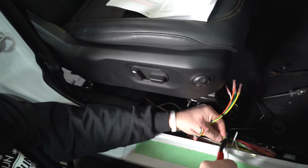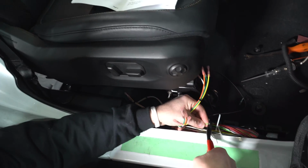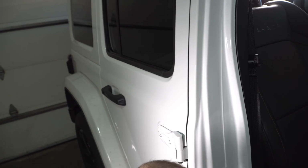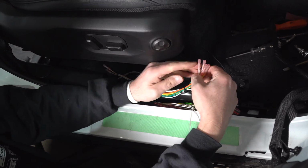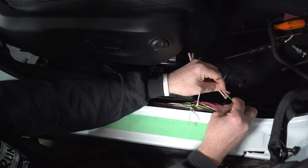Now to confirm that I've got the right wire, I'm going to cut this green wire. That right signal should stop. I'm going to cut it right where I probed it. So the right signal stopped. The vehicle is probably going to tell you you've got a burnt out signal. So now I've got 2 wires. This is always the scary part, but this really isn't a big deal. So the wire from the front of the Jeep, we know, is going to come to this one here.